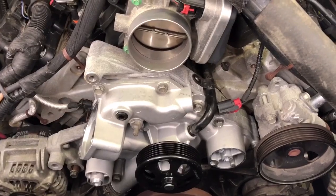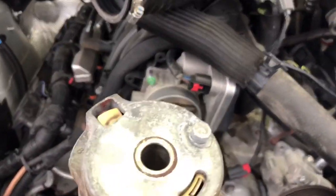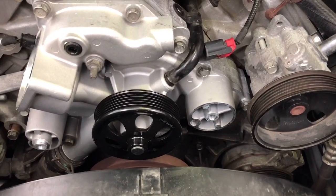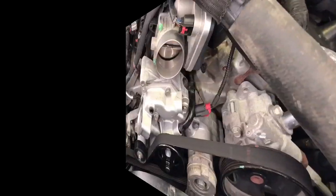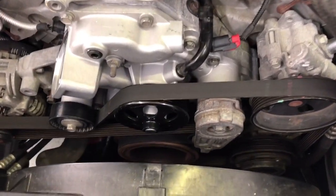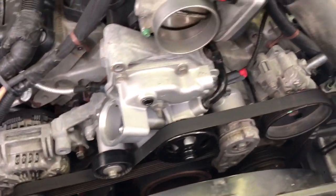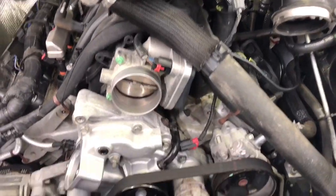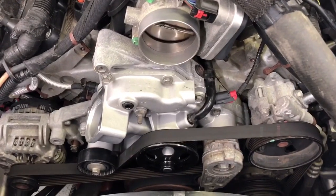One more item to pay attention to is where the idler pulley goes. If you see that little hole in the corner there — on the idler pulley there's a little knob sticking out — that knob is going to go in that hole. If you don't line it up in that hole and you've got your belt back on, you'll have to take it all back apart, because your belt tensioner won't work correctly. Also, before you start taking this thing apart, take some pictures of that serpentine belt, because there's nowhere underneath this hood that shows a picture of how that belt is routed. And take that top radiator hose off first and move it up out of the way — that way you've got good access in there. It's really not that hard to get to once you get that radiator hose out of the way. Take pictures of it, otherwise you could be scratching your head forever.